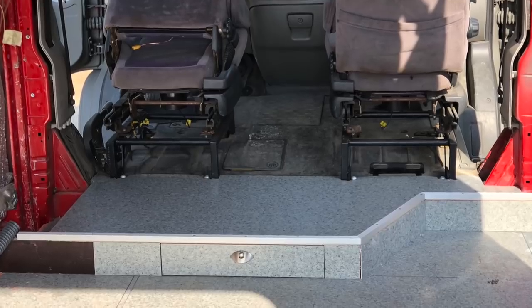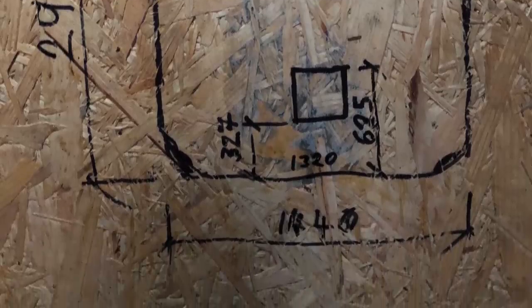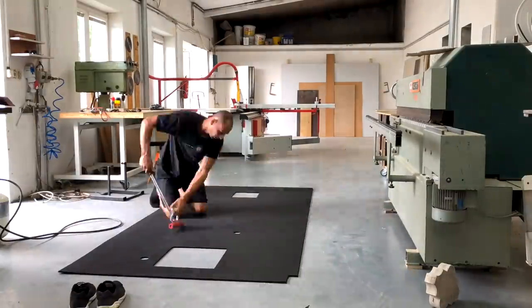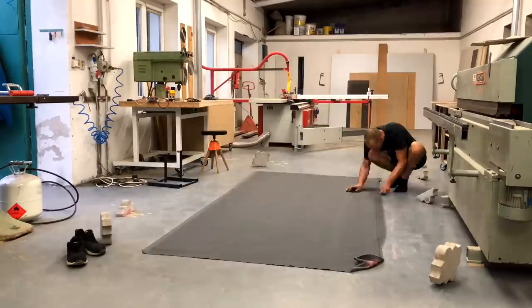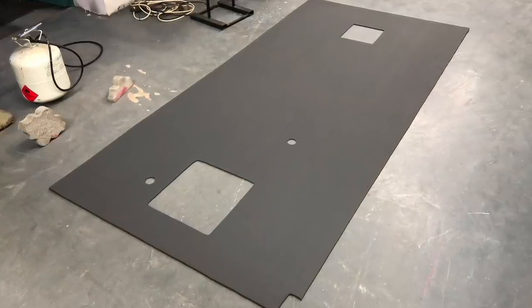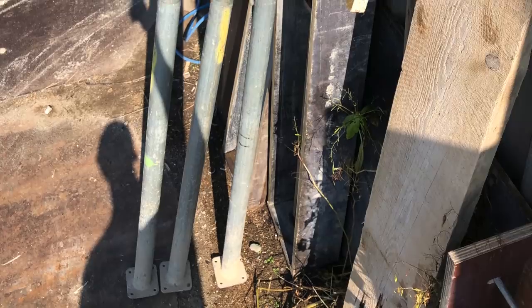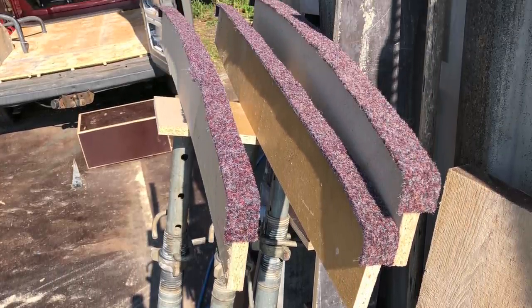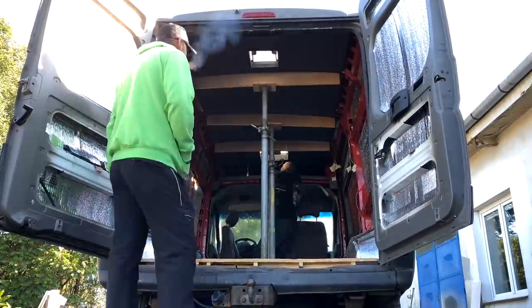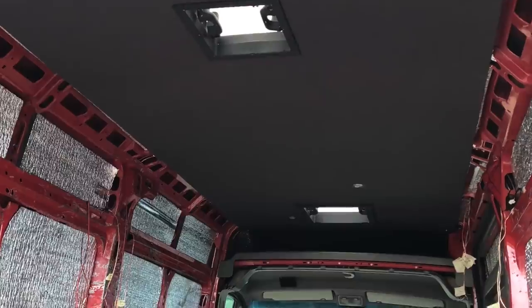The roof panel I measured and cut out of 3mm MDF, making sure all cutouts fit and marking holes for lights. I used thick black fabric from the workshop to make the final result softer and thicker, with a second layer of interior gray fabric for a unified style. I made a few stands out of chipboard that copied the internal roof shape and stapled strips of fabric to protect the ceiling fabric. Installing the panel was easy — I used PU mammoth glue and pushed the panel hard against the roof. By the following morning the glue was cured and ready.